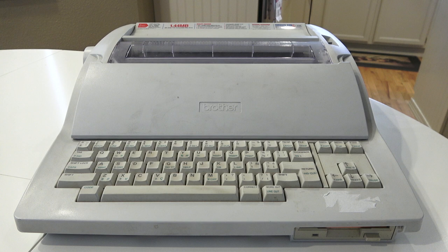The old price — you could see through the sticker — was $125. The new one was $50, which I thought was very reasonable. I checked to make sure the keyboard worked, because a lot of these older machines were notorious for the actual membrane going bad and corroding — the little traces would corrode and a lot of the keys would stop working. This was particularly common with the notebook-style Brother word processors. I plugged it in, the display worked perfectly, no missing pixels or lines, no big scratches. I tested every single key and everything worked perfectly.